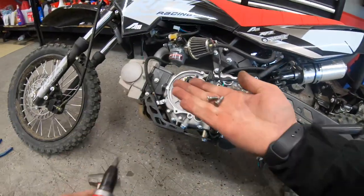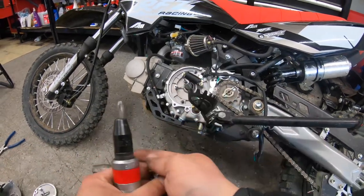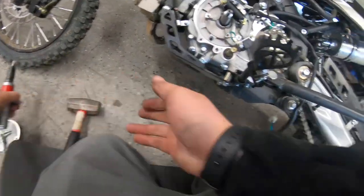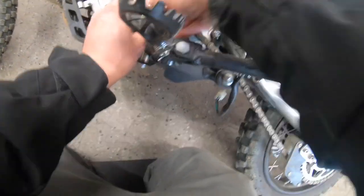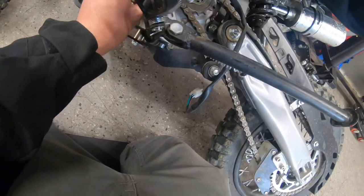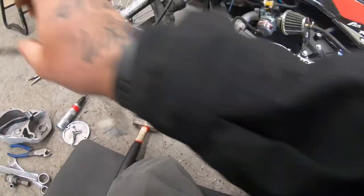Once it's like this it's easier to remove. Here's your screws — they're not stripped at all. Best to use the impact screwdriver because it'll save your life. Regular screwdrivers will break everything. And then you just pull this out — there's your stator.